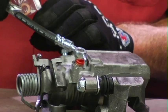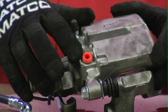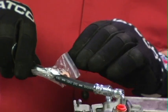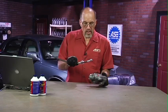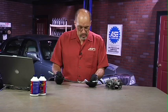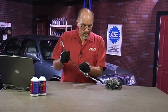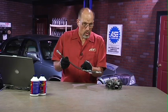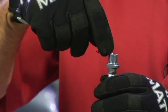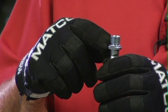These two don't go together, but to give you an example — this caliper here, you can see they've given me a couple of new copper washers as well for when I put the caliper in place. If I'm replacing just this line because it was damaged, got old, or I had some other concern, you can see it's got a spot to bolt right here, usually to a strut or some other part of the suspension. Then this end, where the steel line comes in, is going to be positioned on the vehicle itself.